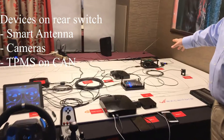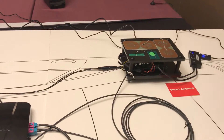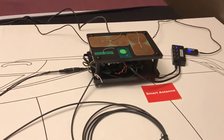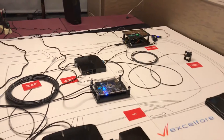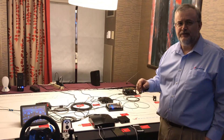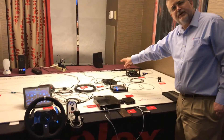Other devices we have on this portion of the network: we have our smart antenna. The smart antenna provides, in one device, the cellular interface, the WiFi interface, Bluetooth for the vehicle, AM/FM radio, satellite navigation, and includes sufficient processing resources and memory to serve as the gateway to the vehicle. We'll come back to why we like that in a few moments. This is on a 100 megabit Ethernet link.